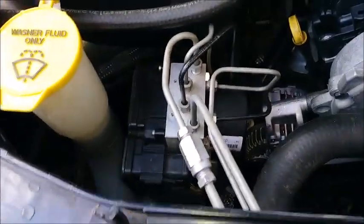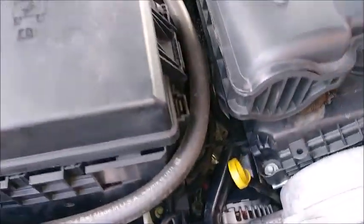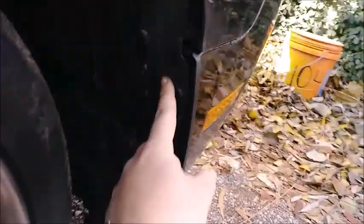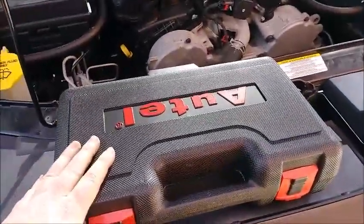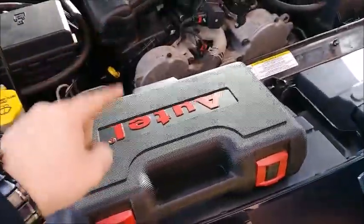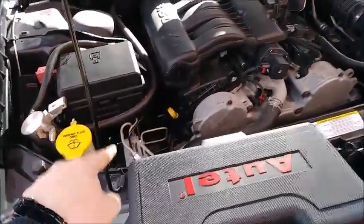Okay, so that's all nice and reassembled. Got the fuse box back down, catch can's where it goes, this is back in place — the three bolts, two and then the other one, three total. Kind of a pain in the ass, 11 millimeter. Got the fender lining pushed back together using those little push pin deals to replace those — that works better. Now all we've got to do is get the Autel Maxi and reinitialize. We're going to clear the codes, then go for a drive and do whatever it says in order to reinitialize that module to this vehicle.